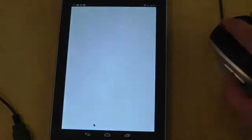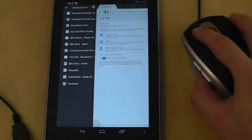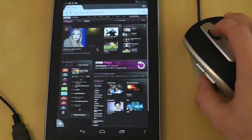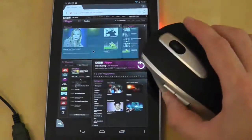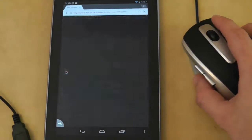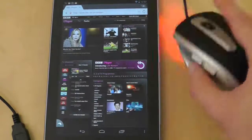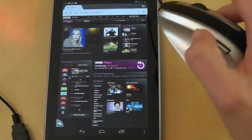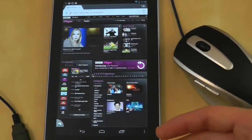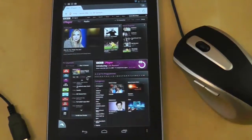If I click onto a web browser, I can now use it as if I was on a PC. We'll just go to the iPlayer as a random test. I'll use the mouse to scroll down and use the right mouse button, which in this case just executes a click. I clicked on BBC there with the right mouse button and it went to BBC One. The back button takes us back, but the forward button doesn't seem to do anything. So the mouse does work via USB, though not all buttons are compatible. A good start for the OTG cable - let's move on to the next test.